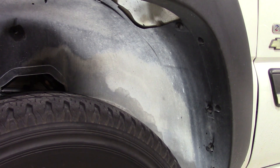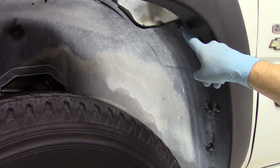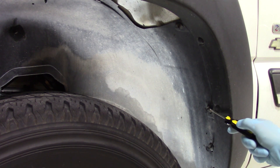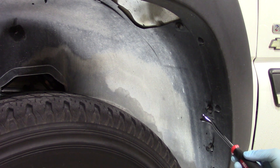Now that we have the batteries disconnected it's time to gain access to the glow plug itself. In order to do that we're going to have to remove the driver's side fender lining. I already have a few of the clips popped out, but we're going to have retaining clips going all the way around the driver's lining itself. To get those out you can use a multitude of tools — I started with a screwdriver to get a little bit of clearance and then used a retaining clip removal tool to get it the rest of the way out.